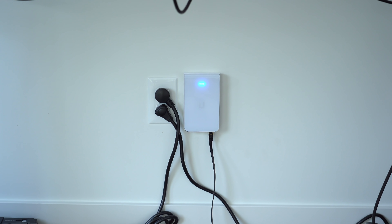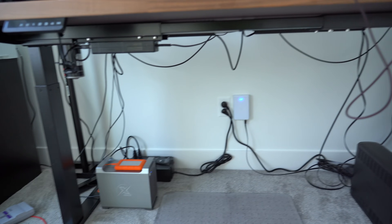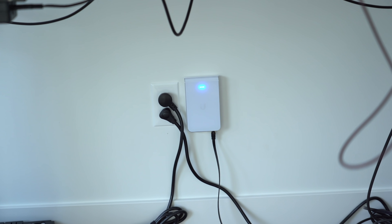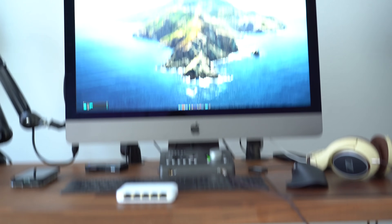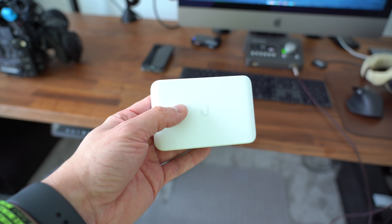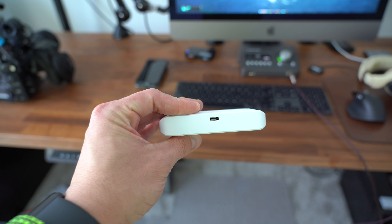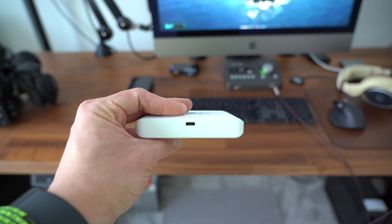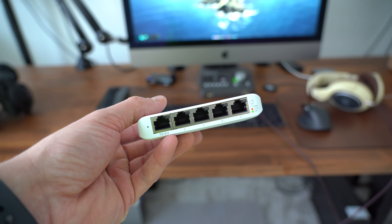Here's the final install of the in-wall HD. It looks great and I enjoy the fact that I can power this over Ethernet and lessen the cables under my desk. I did encounter one issue though: when I want to communicate with my Synology faster, I have to enable jumbo frames through ports and the in-wall HD just doesn't have that capability. So when trying to communicate at a faster data rate downstairs to my network cabinet and my Synology, this thing isn't going to cut it. I came across a solution: the Flex Mini — a $30 switch that allows for power over Ethernet through one port and has USB Type-C if you don't have PoE. It does support jumbo frames, so I'm going to swap the in-wall HD out for this and move the in-wall HD to a different spot to expand my network through mesh.